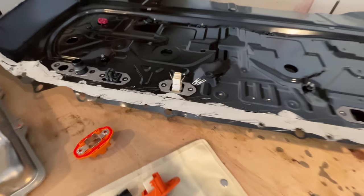The HVIL is a loop that won't allow the contactors to close unless you actually have cables plugged in. This is so you can't turn on the battery and shove your fingers in the holes and die. I could just jumper these wires inside the battery and forget about the broken pins, but that seems unsafe. Sometimes I like to stick my fingers in mysterious holes.